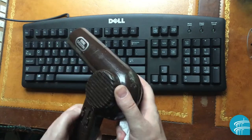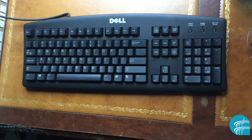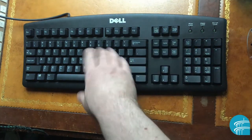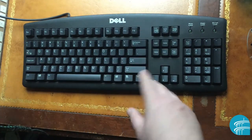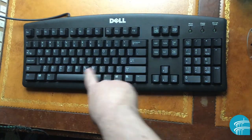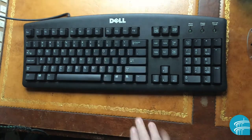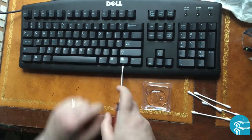Any drinks like soda have a lot of sugar, and sugar is what you have to worry about — it works its way in and starts corroding. Even if you clean it up, the corrosion is still there and the keyboard will eventually fail. So I'll show you how to take out the keys and clean up the sticky residue. Just get a screwdriver and pop the keys out — they all snap in and out.